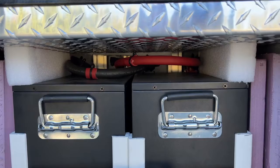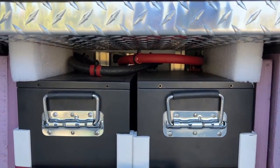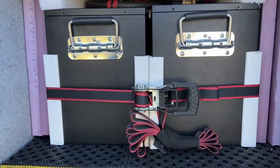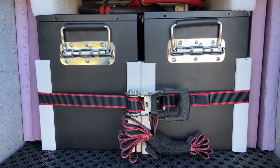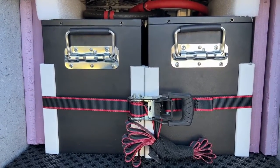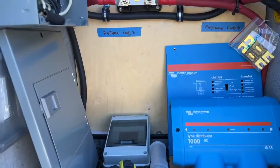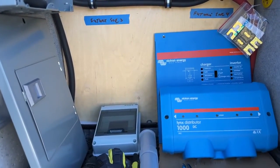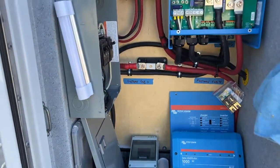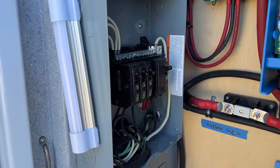Those are four cables wired for 12 volts. Each battery is 12 volts at 206 amp hours — let's call that about 2,500 watts per battery — with the opportunity to add two more future batteries right here. With that said, that concludes the DC part, and we'll go inside and walk through that. But before we go, let's look at the AC parts.